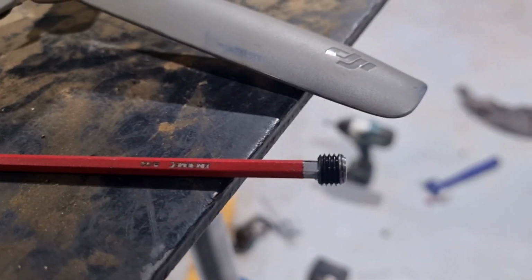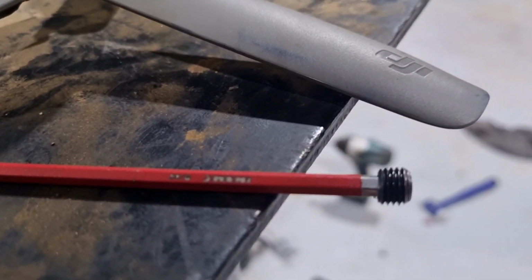Right, if we can zoom right in, that's the top one. There it is down there. I'll pull it out in a second, but I've got a drill hole in it. I ground the grub screw back, so it went down nearly to flush. So we've got plenty of oil that'll go past it and oil the cam bearing. Let's pull it out and I'll show you. All I've done is I just ground it down, made it a little bit shorter, so it goes flush.